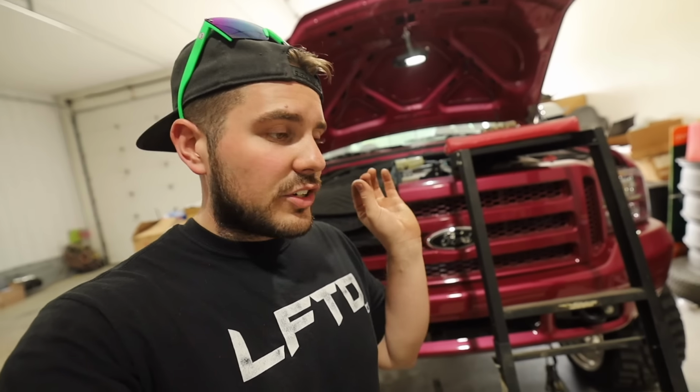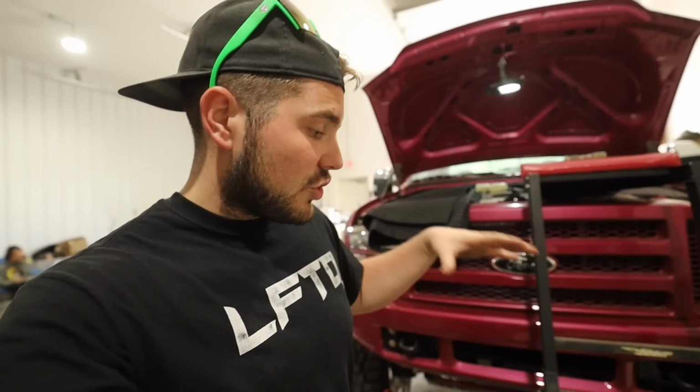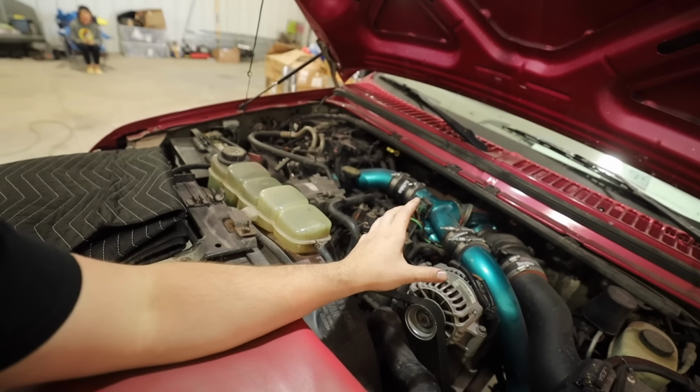We went out with a full stage 2 200 over injector. Factory HPOP, they said, in a hot tune may not be able to keep up with it, but it won't damage it. So you're not gonna be able to get the full power out of this until we upgrade the HPOP,